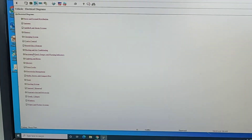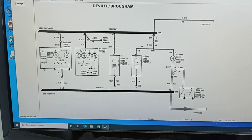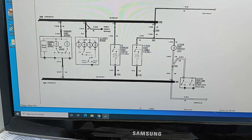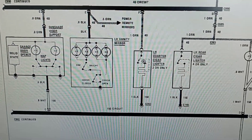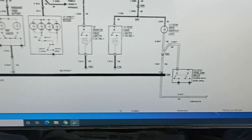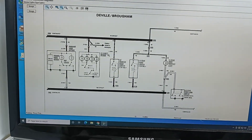So I was following the interior circuit to see where that wire goes, and it goes to all the interior lights, the rear cigarette lighters, the passenger door cigarette lighter, the map lights at the top of the ceiling, the door courtesy lights, and the door jam switches.